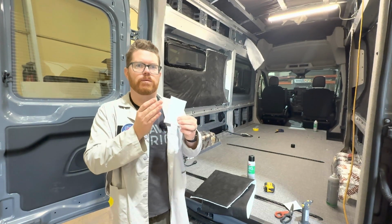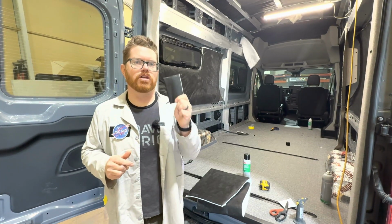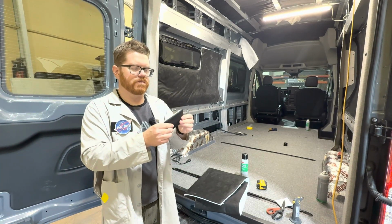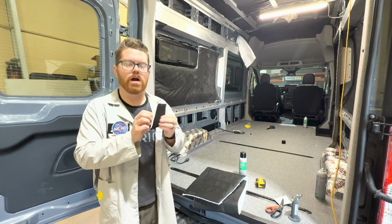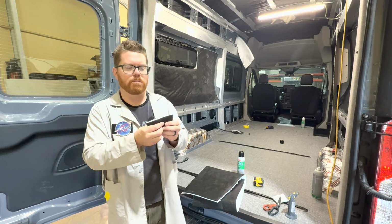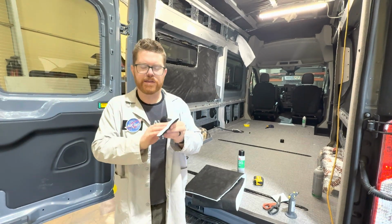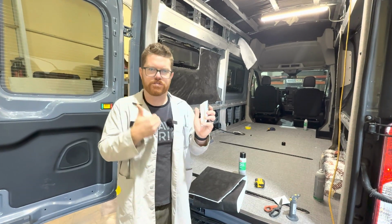This is going to help with sound dampening as well as absorb a lot of sound, and 3M Thinsulate is actually designed as a sound absorbing material. So its first job in the world, and what it was designed to do, is be a sound absorber and a sound dampener. So this is made for acoustics, but it also has some R value because of the nature of the material. So it's a 5.2 R value at 1.5 inch loft, which is what this will loft to. This came right off the master roll, so it's compressed, but it is going to loft over time. And actually, some of the insulation that's in the van now has lofted, so we got a nice pillowy insulation. The main thing for it is going to absorb sound, which is going to give us really good ride quality. So we want to glue this open baffle directly to the wall of our van.